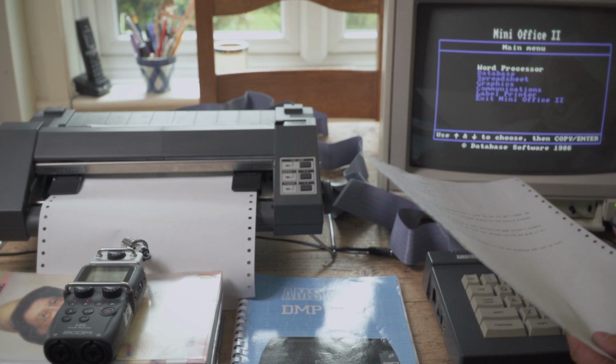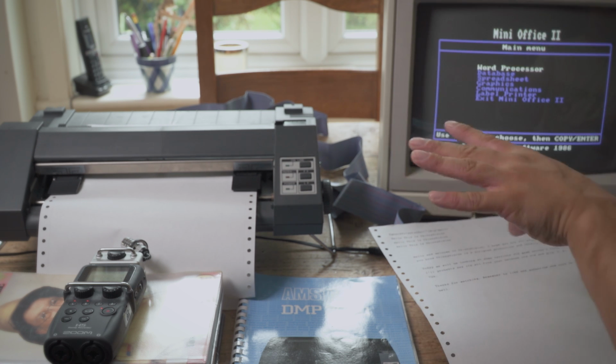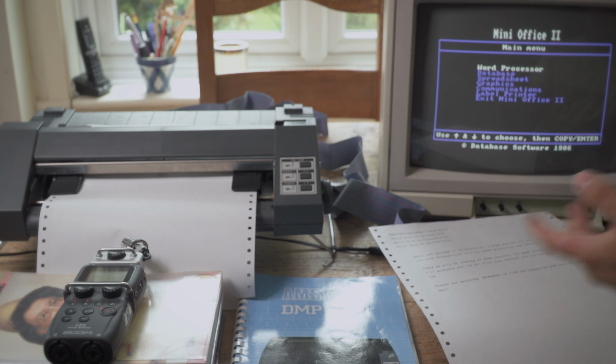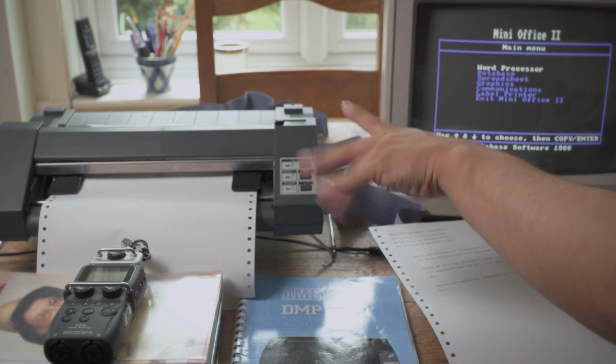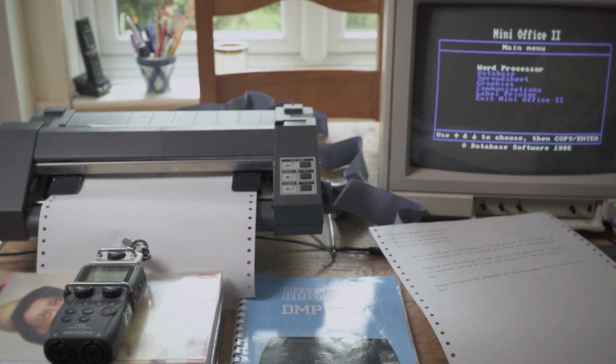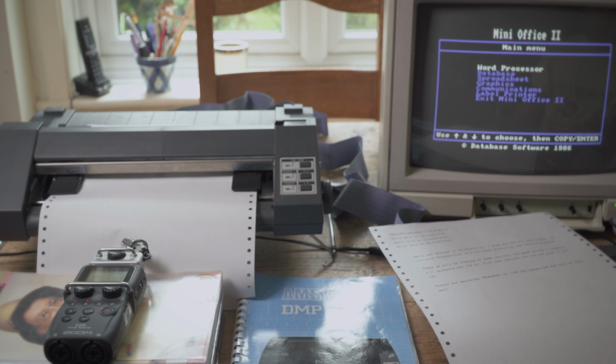You'll also have noticed when I was doing that the print computer was tied up for a little bit until everything had spooled through to the printer, even on that small amount of text. The printer actually has 2K of RAM. It is upgradable. Annoyingly, my dad upgraded my DMP 2000 to 8K. You put a little memory chip inside and it suddenly has more memory. So at least it would spool the job and then the printer would carry on and you could do what you like on the computer.